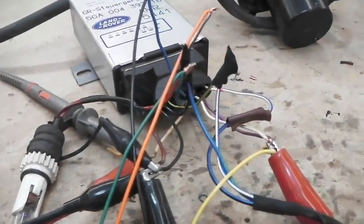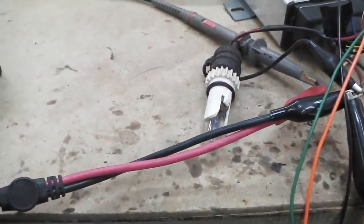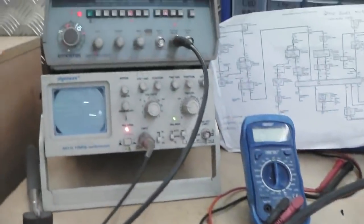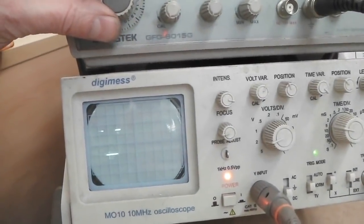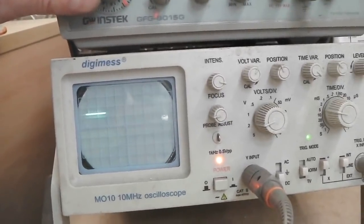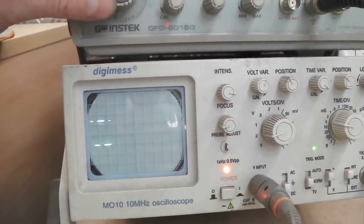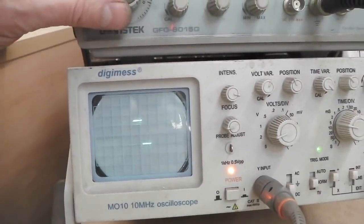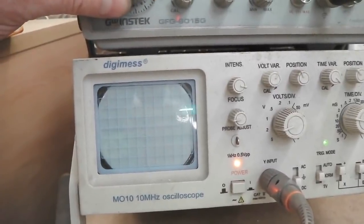Okay, that's the little junction of cables. 12 volts in, some grounds, my speed signal in, and then a monitoring cable which refers to the scope screen. There you can see the waveform that we talked about on the screen. Look, as I increase the speed, the waveform changes, the clicks get faster or slower depending, slowing down, speeding up. Your camera sees it differently because of the way that video systems work and display this, but you can see that that's just the speed.